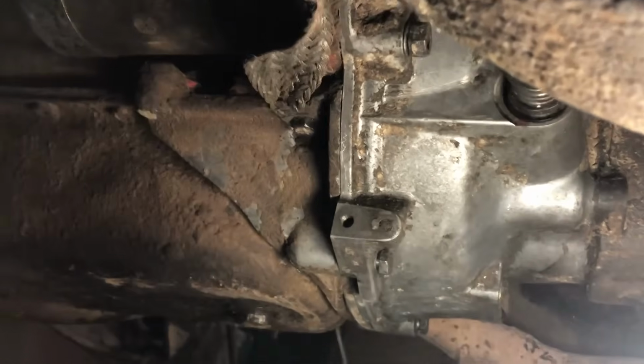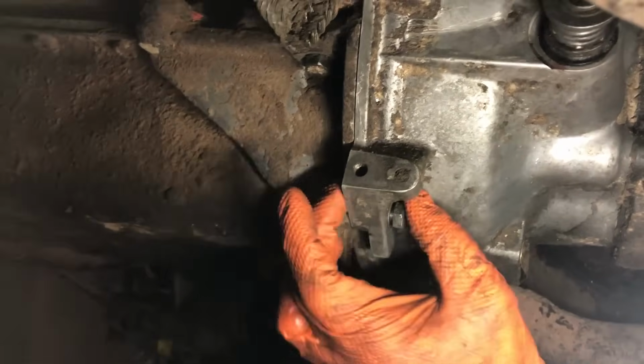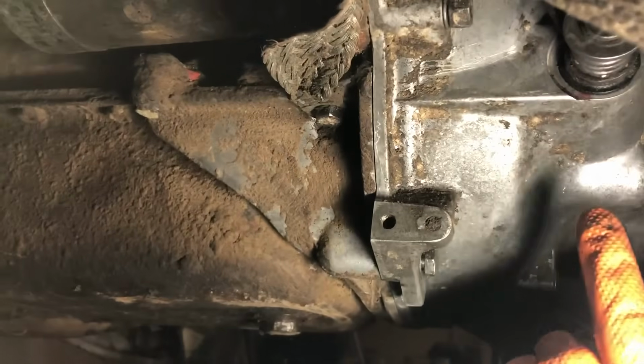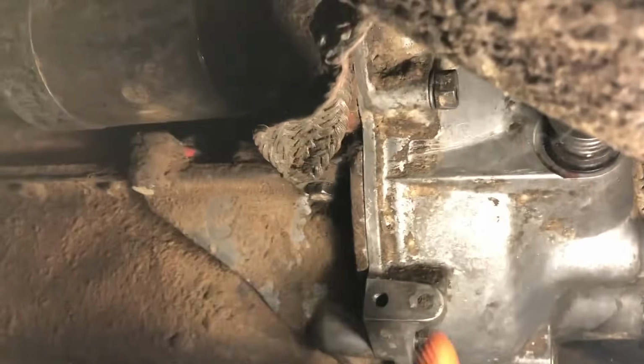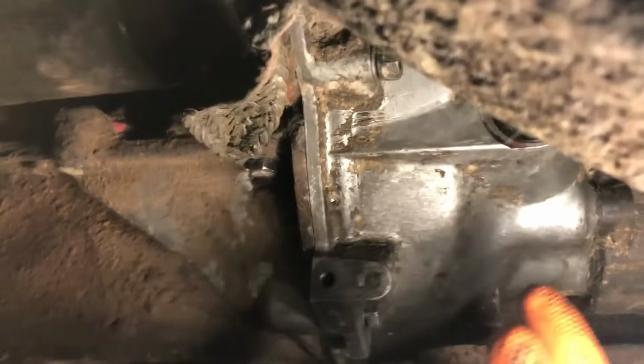It's possible the disc inside gets a little wiggled around when you are installing the transmission, and so it's not exact. What I was trying to explain earlier was that you never want to have the final gap closed by tightening the bolts. That means that there's tension somewhere in between the alignment of the clutch disc, the pressure plate, flywheel, pilot bearing, and the input shaft of the transmission, or even the throwout bearing.